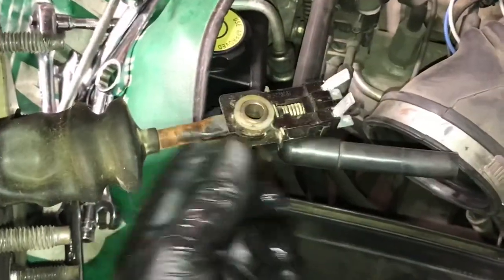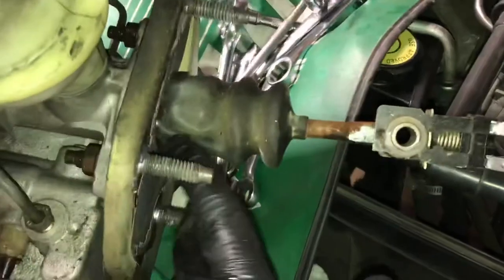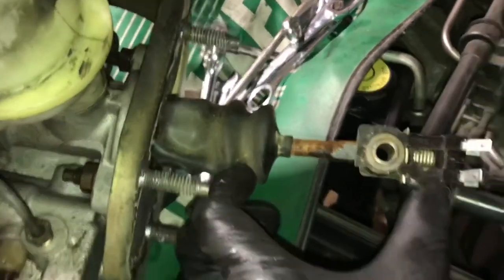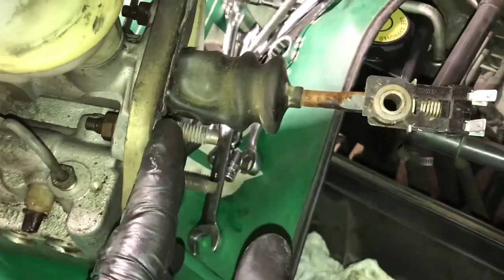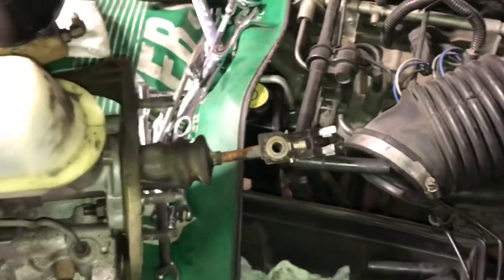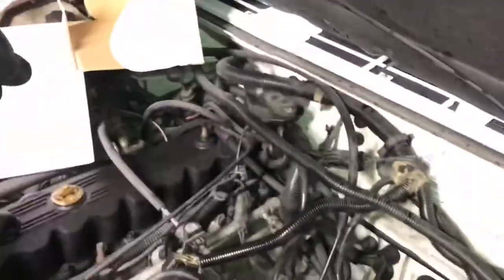Let's check the length of the push rod that came out. I'm going to swap over the switch. The push rod — I think it's going to be the same for '95/'96, the length is the same. If you get like a WJ Grand Cherokee they had a different rod length, so you'd put a spacer in — there's plenty of threads, you can do that. Not too bad — did that take an hour? I might keep the harness and the pump in there — we'll see, might be good to take it out.